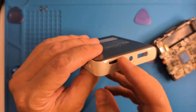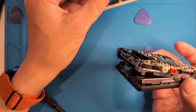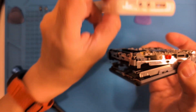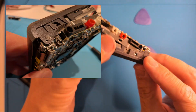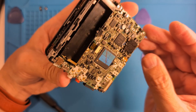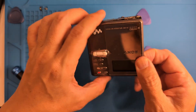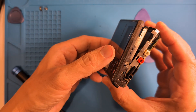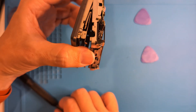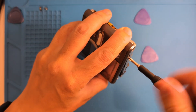It's pretty clean in here. Take note of the hold switch, since we need that to be in the right place when reassembling. Here's another key piece to look out for: this spring provides tension to open the door. Take note of the position so we can put it back in properly. Let's go ahead and get the lid off — just a few screws. These screws are different, so please keep track of them in a separate area.